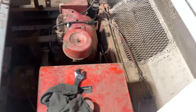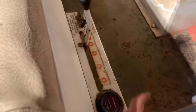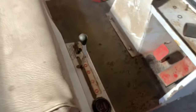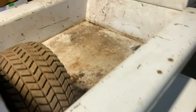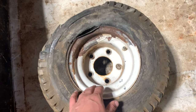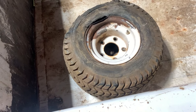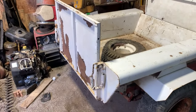Someone's really done a number to that wire right there. But other than that, it looks to be all original. If it's been repainted, they did a real good job — just flaking off here and there. The wheels were originally golf cart wheels, a 5x4.5 bolt pattern, 8 inches in diameter and 7 inches wide. I'm actually looking for a set of them because the current tire is rubbing the fender. That thing folds down — it's quite a piece.